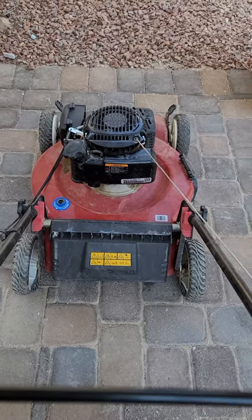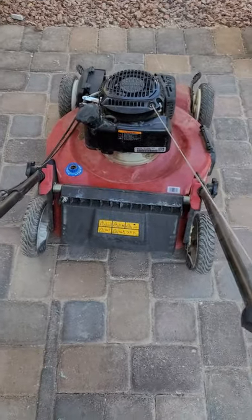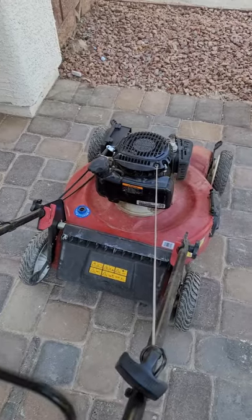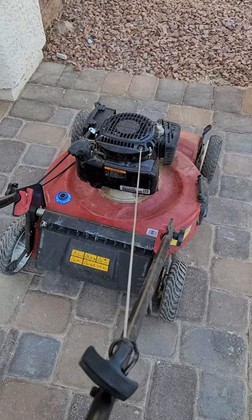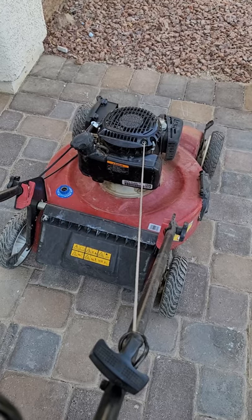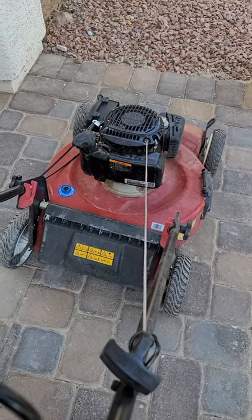And folks, I think we may have found the problem. Let's try it again. So that just goes to show, you never know what you're going to find on these. If you've had what you think is a fuel problem and you've done all the fuel things and you're still having problems, it might pay to check out that flywheel key, and it might pay to check out that coil. Because that's where the problem lied on this one. Anyway, if you've got any questions, let me know — I'll do my best to help. Good luck, and thanks for watching.